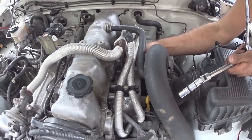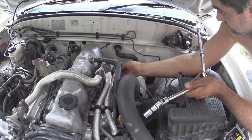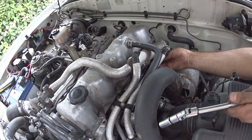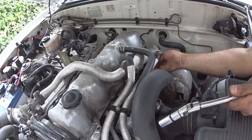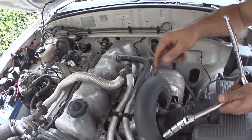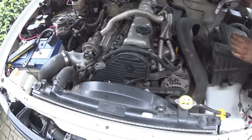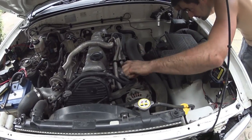We should be able to lift the entire EGR system pretty much straight off. Not only is it weight reduction, you can sell the old EGR cooler for some beer money. That's all the bolts - it just needs a bit of love with a hammer to set it free. We'll take the coolant lines off next with a 10mm, cut this coolant line shorter and link it to here.